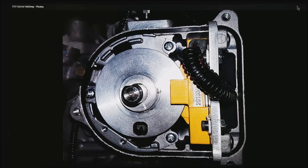Last, this happens to be a distributor that has been modified. What we did is remove the original rotor and then made a chopper wheel to sit down in there — cut a hole in the chopper wheel. This is an Excel piece known as a points eliminator: an optical sensor that shoots through the hole every time it comes around, which is where we pick up the engine phase. In the back you can see the 40-tooth gear that is working as the crankshaft position sensor.